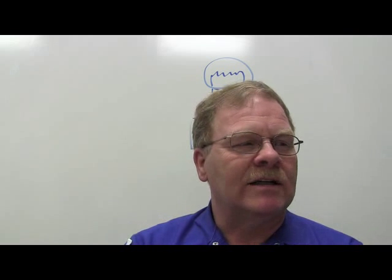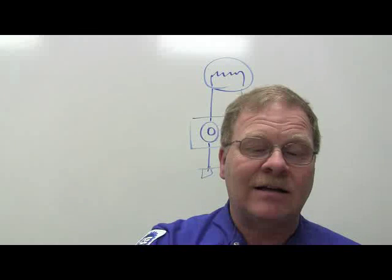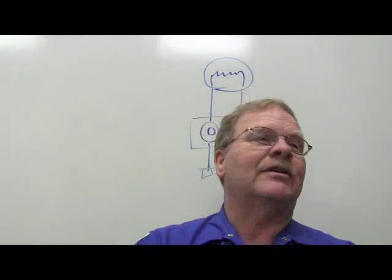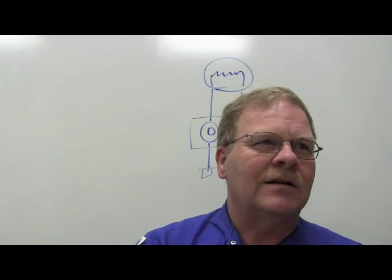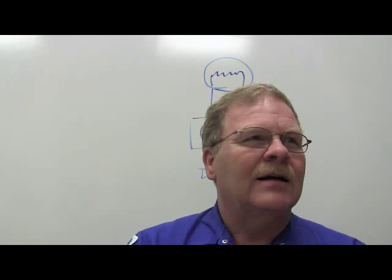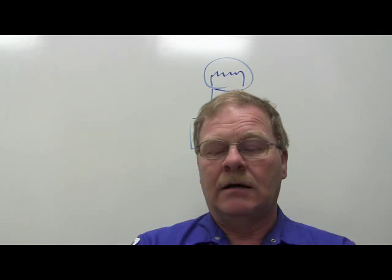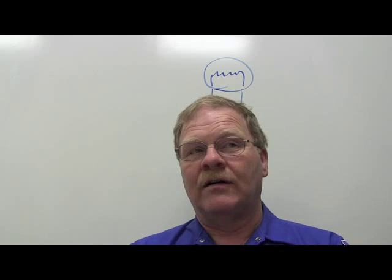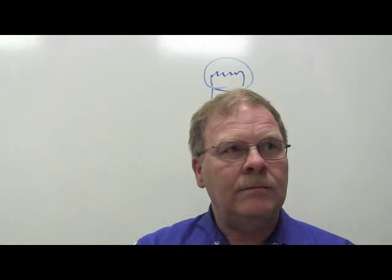When I was working on those Power Stroke diesels, if they pulled in there with a problem and I took the top off that fuel filter and that diesel fuel was red, I would put it back together and drive it outside and say, bring that thing back after you run three regular tanks of good fuel through it. Bring that thing in here with off-road diesel in there because it gels up, it's got sulfur in it. A lot of people say, the ambulance drivers, because the county commissioner can actually sign away that waiver, it's like a tax-free thing. That's the first time I actually understood that.